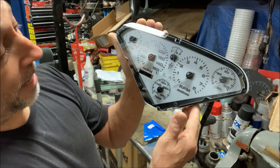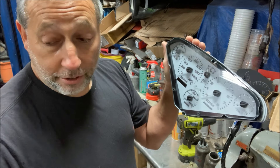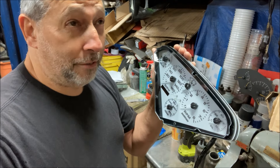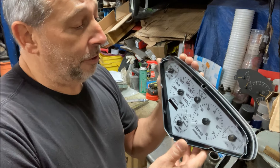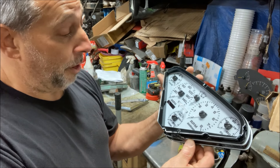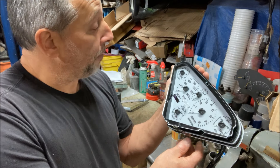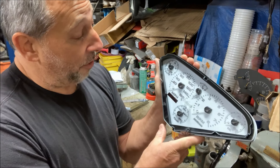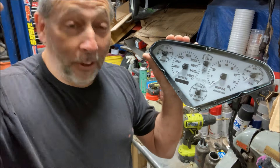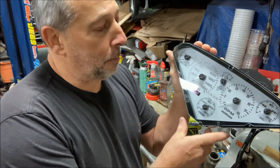There it is — a pretty neat analog gauge setup. It has everything: the gas gauge is already set to zero to ninety which matches the sending unit, and there are DIP switches on the back to configure it for zero to thirty for earlier vehicles. It's an electronic programmable speedometer so it'll be easy to calibrate. And I bought one with purple backlighting — I want to see what it looks like with the purple dash. Hopefully not in-your-face purple, just something cool.